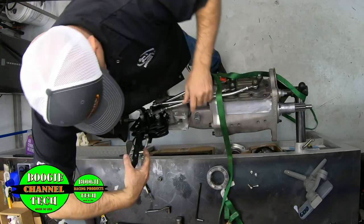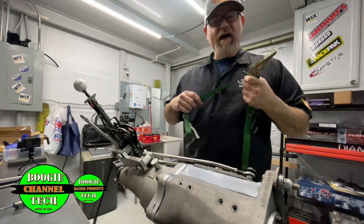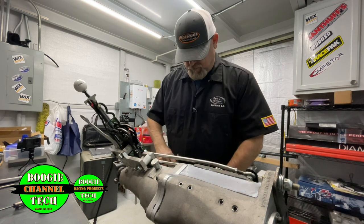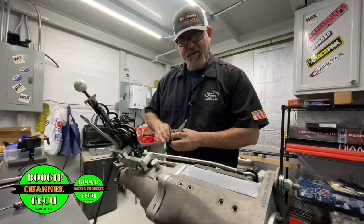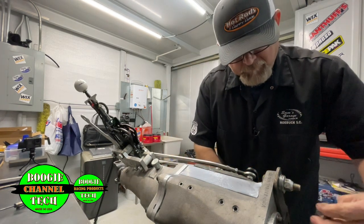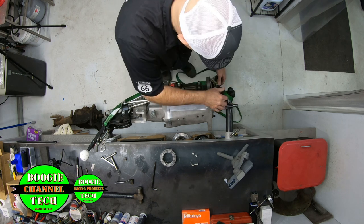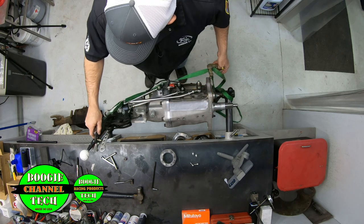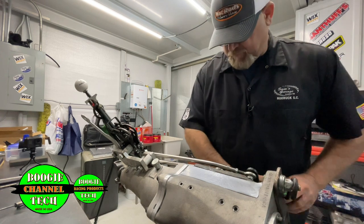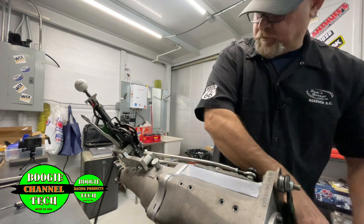All right, let's go to fourth — we're in one-to-one, high gear. Remember, there is a high gear — it's the rear gear. The rear gear in the car is fourth gear. A lot of people think you don't have a fourth gear, but you do. Fourth gear just isn't changed in the transmission; it's changed in the rear end. So when we say we've got different fourth gears, we mean we've got different ring and pinions — that's our fourth gear. We typically set fourth gear first because we can't change it, and then set the rest of the gears after. That's pretty common — you set up the ring and pinion and then set the rest of the gear packages after that.